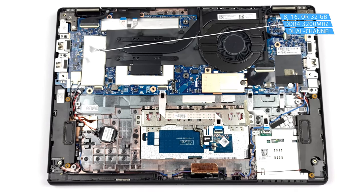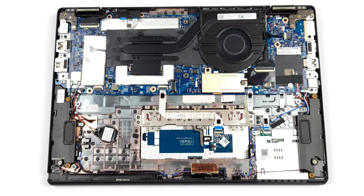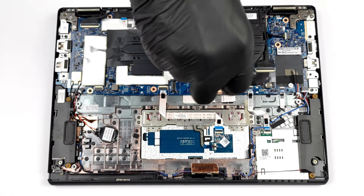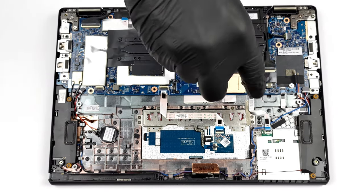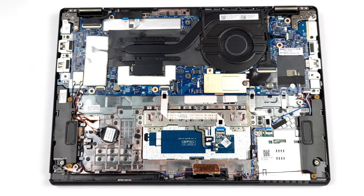Finally, let's check the upgradability. Unfortunately, the laptop has soldered RAM, but due to its portable nature, you should expect such stuff. The storage is accessible through a single M.2 PCIe x4 slot which fits 42mm Generation 4 drives. If you're interested in what the teardown process looks like, we'll have our detailed video down in the description.